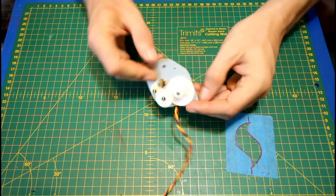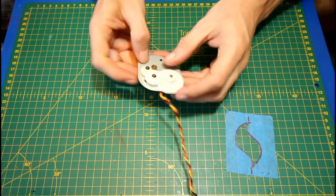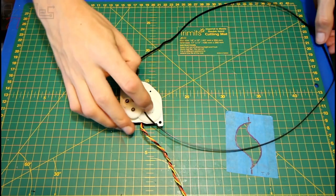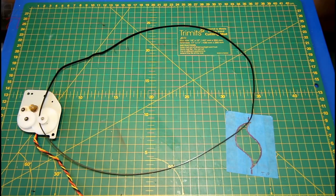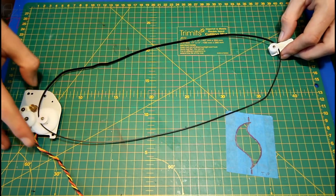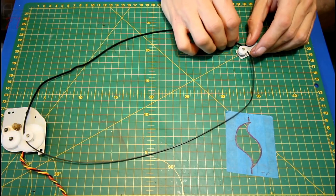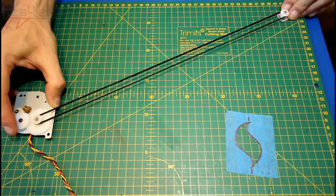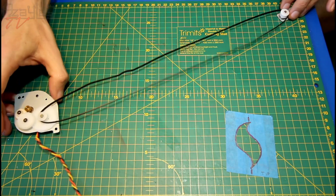That's good because it's an all-in-one unit. It doesn't need anything else to hold bits together or hold gears in place, so I can use that for something else. I've even got the timing belt here, which wraps around that. And of course, the idler gear that goes on the other end. So I could use that for parts for a 3D printer, for example, or a CNC, or pretty much anything you wanted. As long as it's a fairly light load, just pull that tight, drive the step motor around, and you can move this pretty accurately, albeit very slowly.